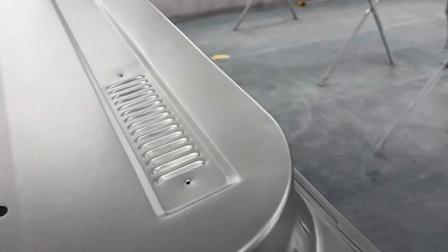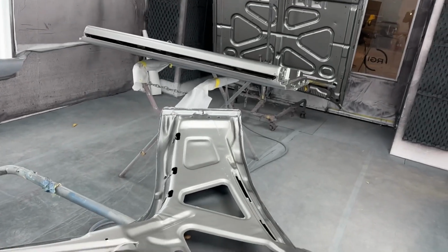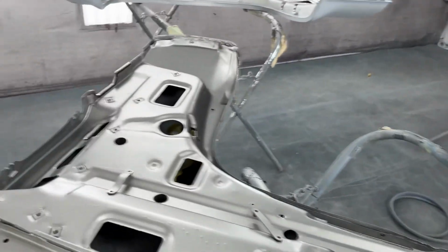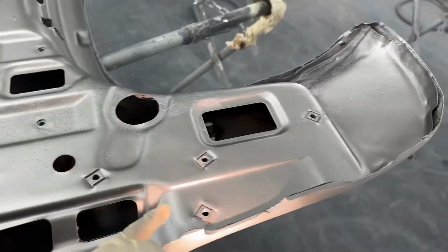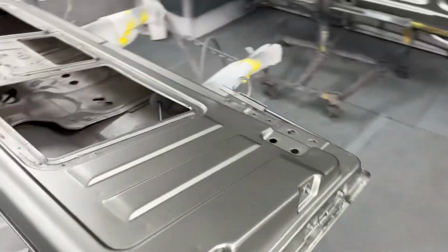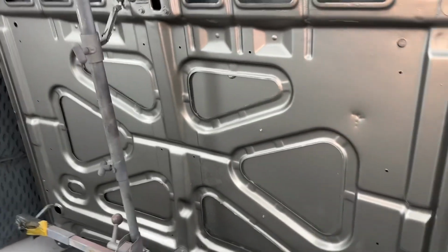Alrighty, check it out. We got base on here, and it's looking really nice color. You can tell on the parts, different angles, it looks different. Literally exactly the same color. That's what I love about this color. It flops in all the different angles. Doors are all jammed up. Might let them sit for a while until I clear coat them. I did use the slow reducer and they're still really tacky. Again, I don't want to rush anything. It's looking nice. You can tell the color, the shade. Looks really nice. We'll go ahead and shut off the booth lights, check everything with the light, make sure I'm covered.